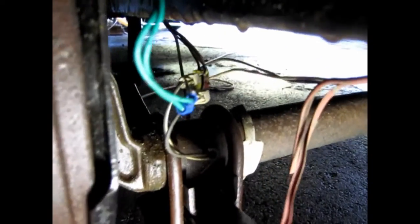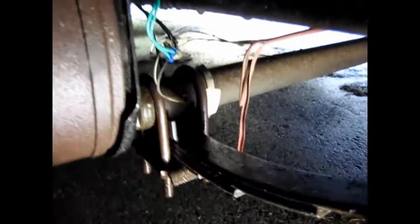Usually when you do this, you have to lengthen the wires for the trailer brake. I came over here ready to cut the wires so I could drop the axles out, and found something pretty cool — the wires are wire-nutted together. In addition to that, one of the wires is broken, which explains why my trailer brakes were not working the last time I took this thing camping.